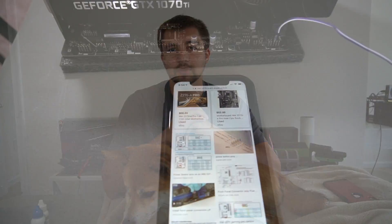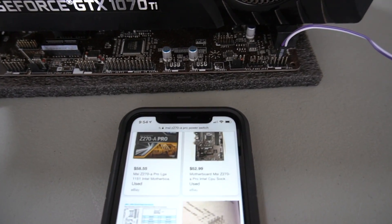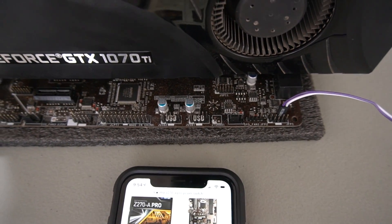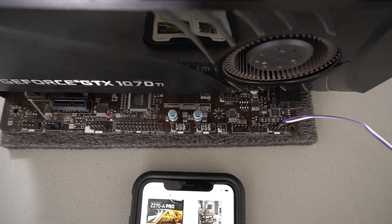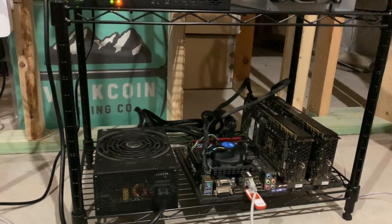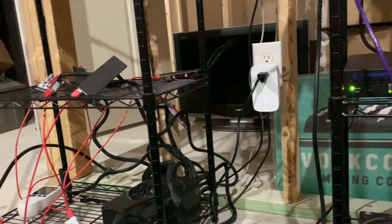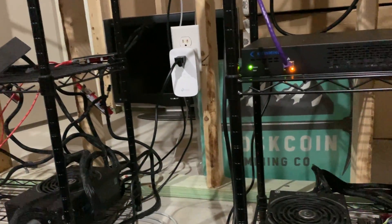Finally, all you need is a power button. Where it connects on your motherboard will vary by model, so look it up. On this MSI Z270 Pro motherboard it goes right here. Also plug in Ethernet for a direct internet connection - this is better and more stable for mining rigs and is always recommended. From there you can log into your SimpleMiner dashboard and start controlling the rig.